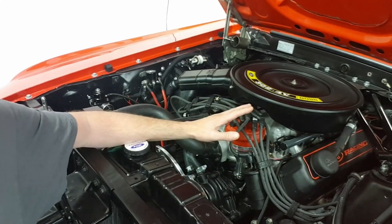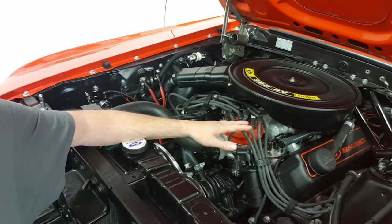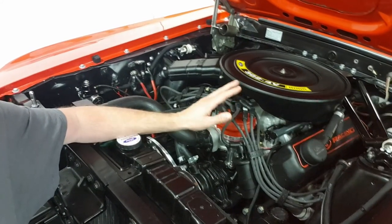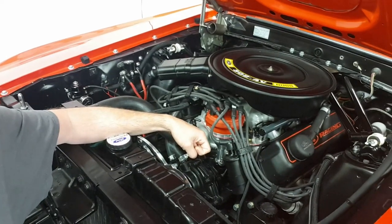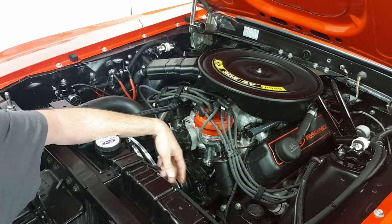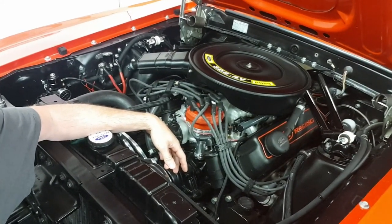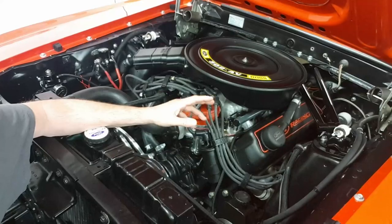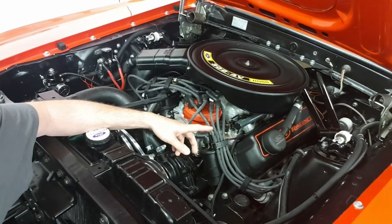And also I need to change out the camshaft this winter. So actually the system has been a little sketchy in the low RPM due to the camshaft. It's an aggressive one. It pulls from 3000 RPM, and originally it was built for an automatic transmission with a 3000 stall torque converter. And when I had that, it was great. But now there's a TKO 600 manual transmission, so the camshaft is not performing at low RPM. I think the EFI system reacts to that, and it's a little sketchy in the low RPM. So that's an issue I will address this winter.